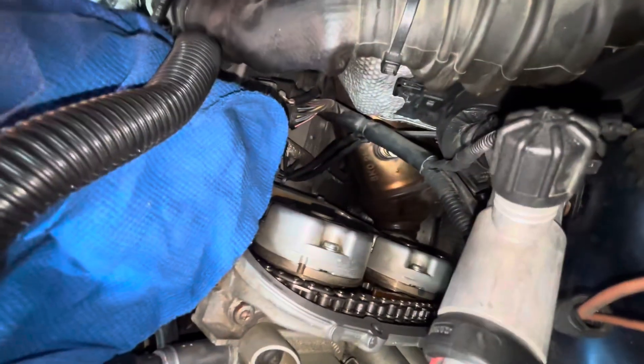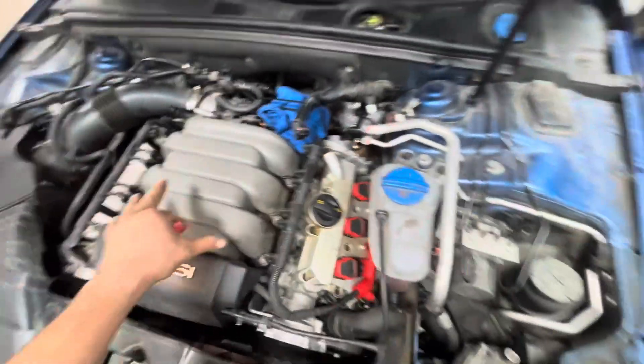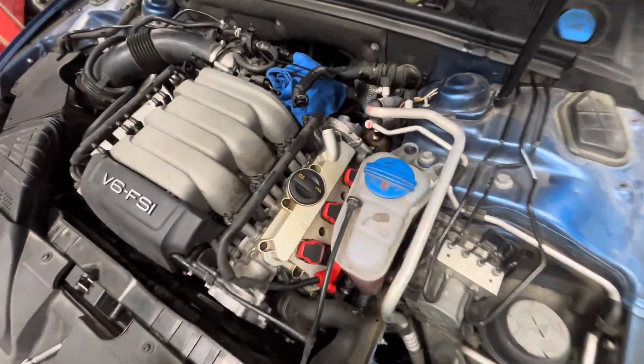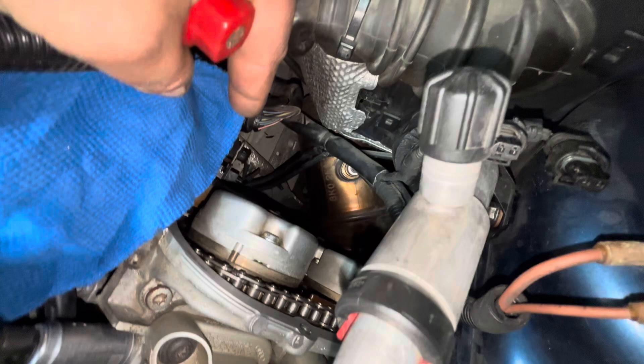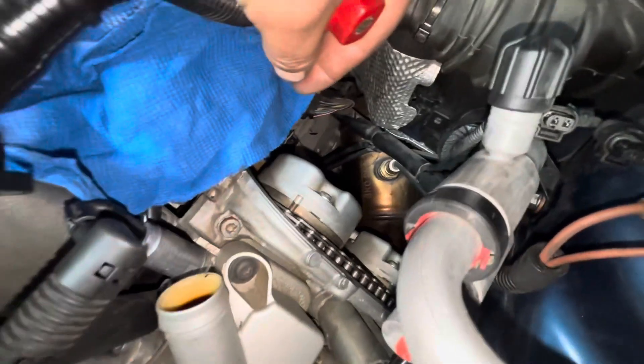It's pretty not that bad to get to on the engine with the 3.2 liter. If it's an S4 or something with a 3 liter supercharged engine, it's much harder — even though it looks like pretty much the same kind of thing. It has secondary air injection gate valves back there that block the covers, and to get those off you have to pull the heat shield that goes around them and then get the catalytic converter out of the way, and it ends up being a much much larger job.